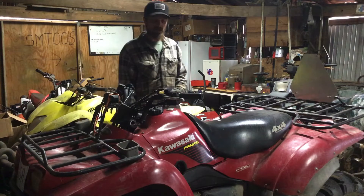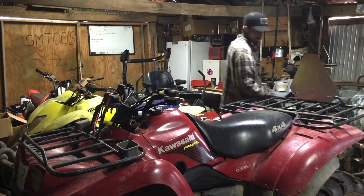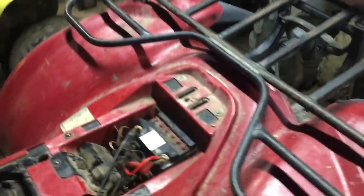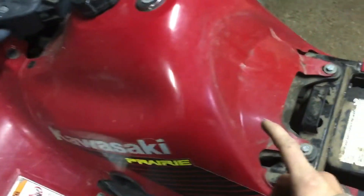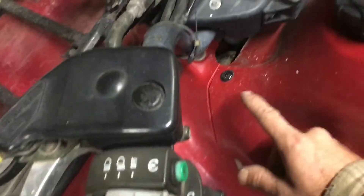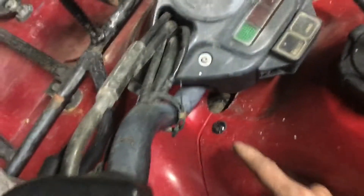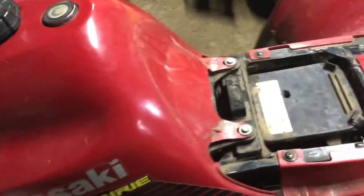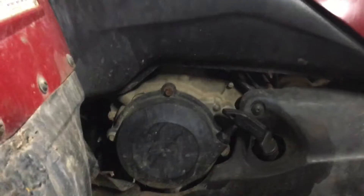So we're going to show y'all this. The first thing you're going to want to do is remove the seat — get the seat out the way. This gas tank plastic is going to have to come out the way, and the gas tank. You're going to remove those two bolts right there. Take your gas cap off. Usually there's two Phillips head screws right there — one here and one there. The dude that had this before put a big old bolt in there because he lost the metal bracket that screw goes into. But get your tank plastic off there, get your tank off there. Then there's a few more plastic pieces down underneath here we'll show y'all how to get off.